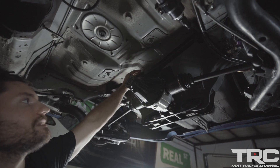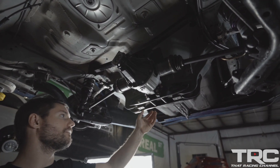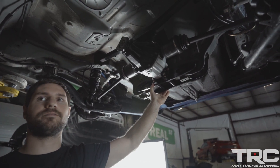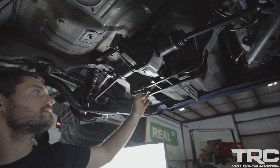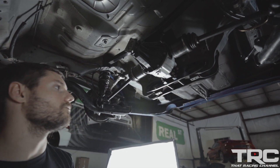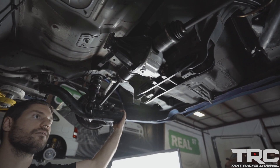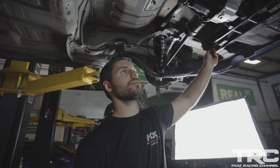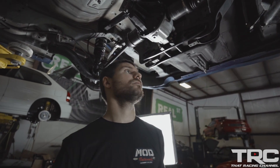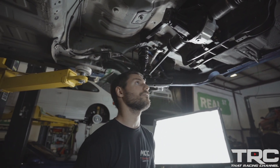This rear diff needs this brace on the top and then it uses this hub-steady performance brace on the rear. The hub-steady performance on a DC-5 chassis is a lot less work than it would be for, like, a Civic because you don't have to cut out the whole factory brace — you just have to drill holes in it for it to sandwich together and fit the control arms. We don't have the control arms yet, but we do need to get new control arms for the rear to the trailing arms. We found that they're a little bit different, so we have to use spherical bushings on the inside for the taper that these CR-V trailing arms have. They're not flat like the RSX, so the control arm doesn't sit perfect on the rear — that's one thing you have to consider when you get this kit.